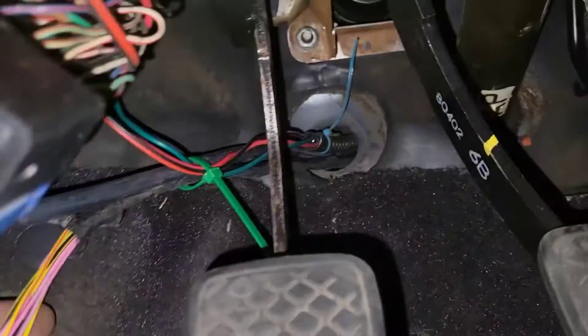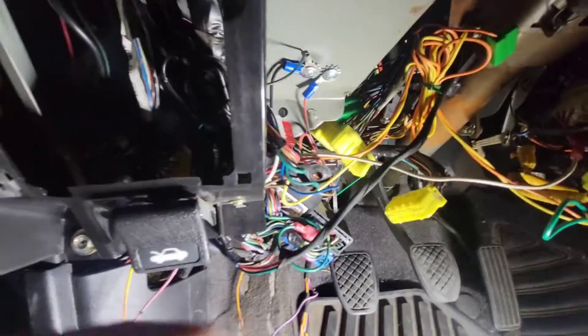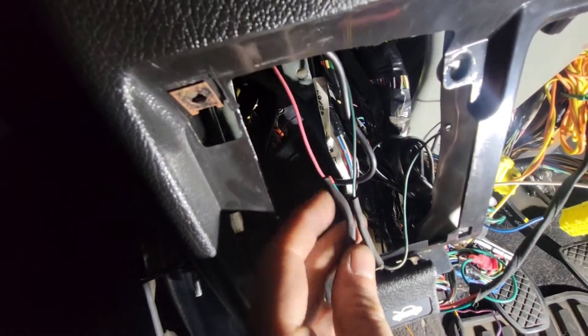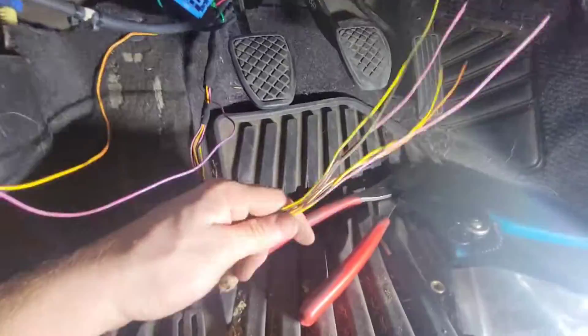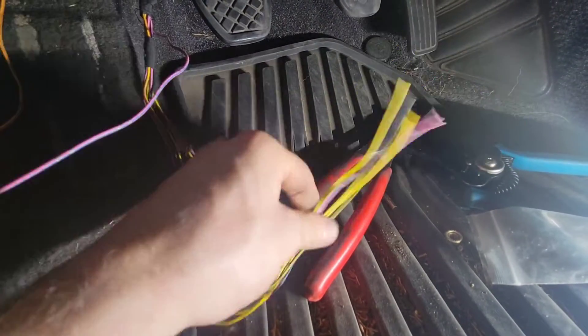Okay, coming down here — we got our wires ran through. This is our bundle. We just got the ECU unplugged; there are four ECU connectors. We need to go through and add in the wires. We got our gauges all hooked up — tied in the ground and teed the two gauge powers together into one, tying that into the relay wire that already runs through the firewall. This one's our signal that goes into the harness we made. Now we just have these remaining wires that need to hook up to sensor ground or the ECU for voltage reference.